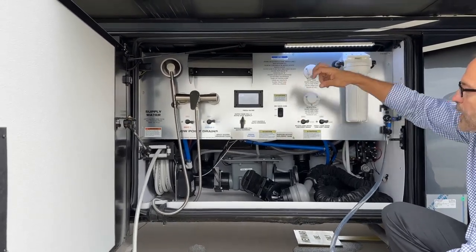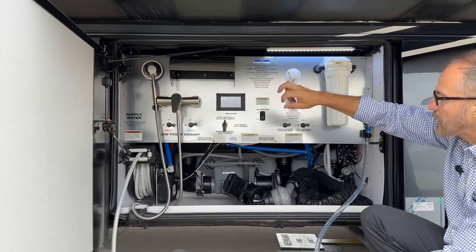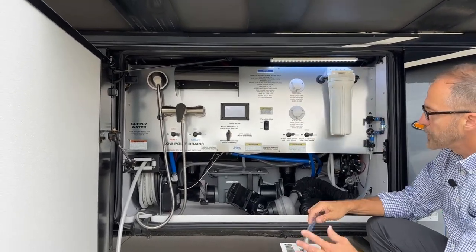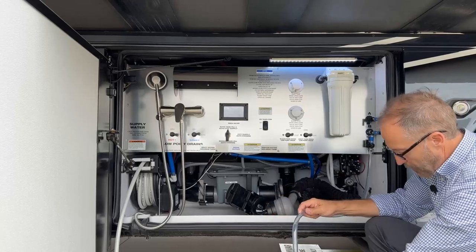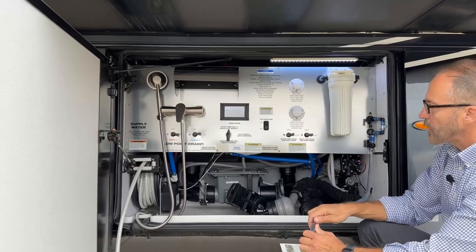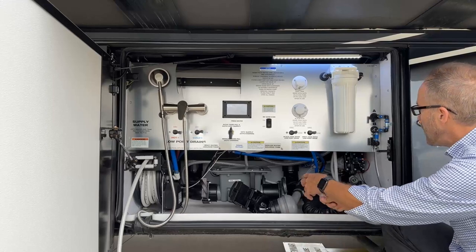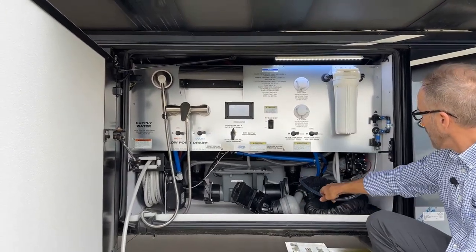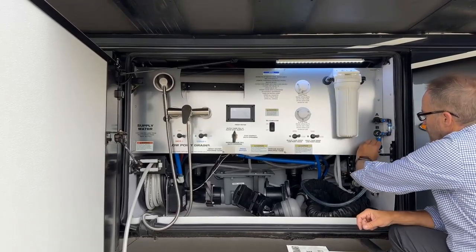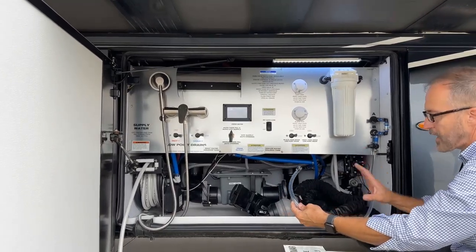Go into the coach, open up the drain of the sink, turn the sink on hot and cold in the bathroom and in the shower, and all of your appliances will need to be turned on so that the potable antifreeze will go into the water lines and all of the appliances for winterizing. Once finished, pull this out, put my plug back on, turn the water pump off, and then go back to these and put them back in their original position. You may see a little bit of antifreeze left in this line, but that's okay.